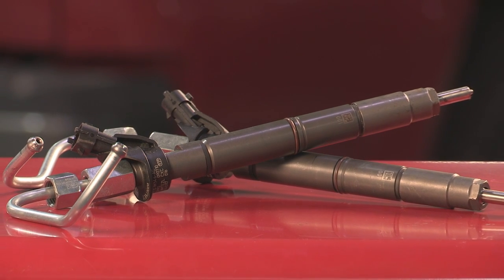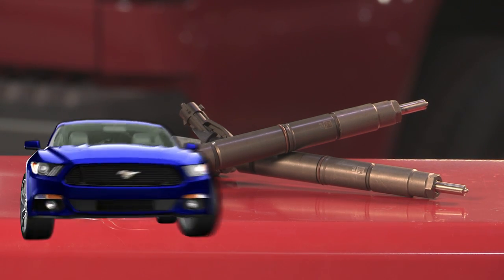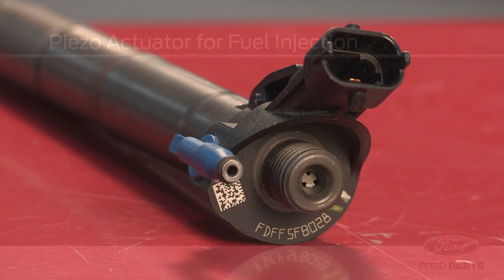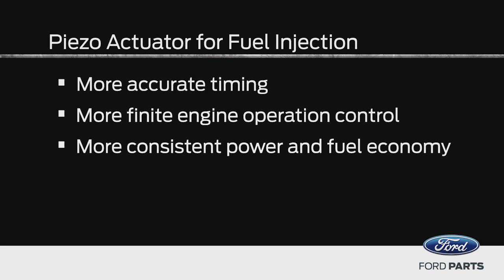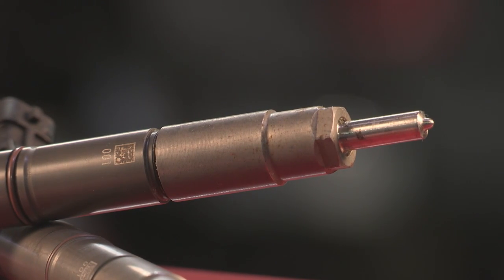When we sat down, Gavin also gave us more details about what's changed on the 6.7 liter diesel fuel injectors and why it makes a difference to your customers. The 6.7 liter diesel fuel injectors use a piezo actuator rather than solenoids to control the fuel injection. Each injector's capacity is unique — it's assigned a fuel flow trim code known as an Injector Quantity Adjustment or IQA. The benefit of this system is that it provides more accurate timing, giving more finite engine operation control and more consistent power and fuel economy.